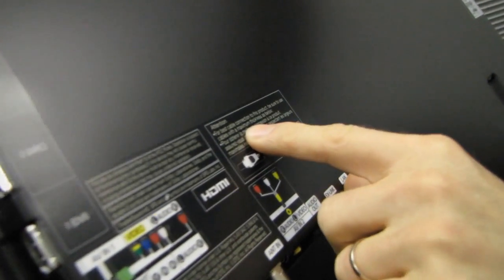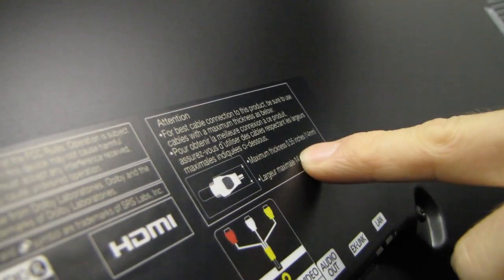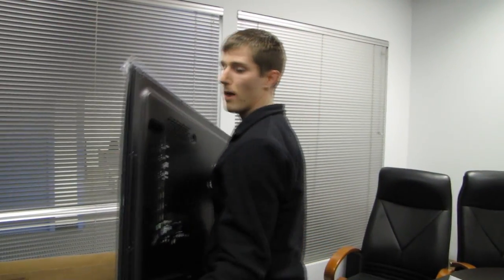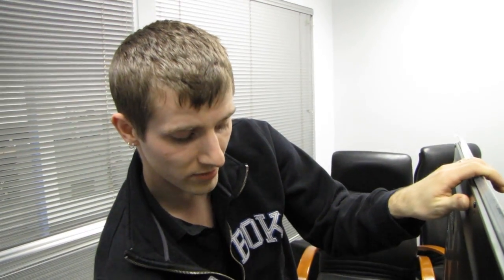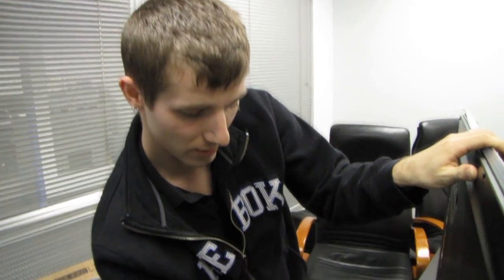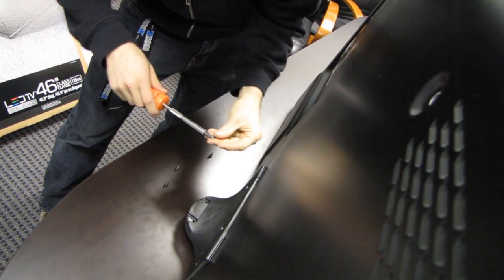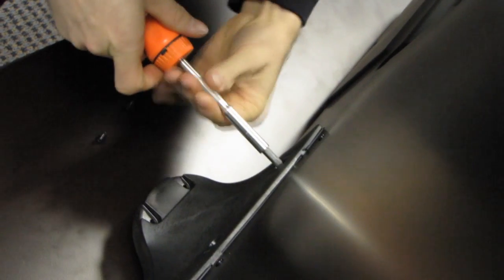This is interesting — for best cable connection to this product, be sure to use cables with maximum thickness as below. Maximum thickness 0.55 inches. So we're going to go ahead and mount this to the stand, and then we'll be pretty much ready to show it to you properly. In terms of setup, all you got to do is take the stand here on the back and slide it into position. It's important to slide it into position rather than trying to push it, otherwise it will not line up correctly with the bottom two holes. So we go ahead and put four screws in here.